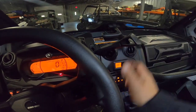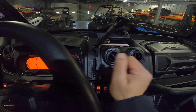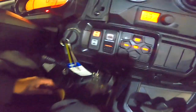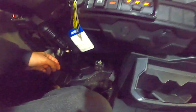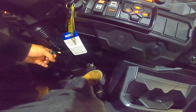The gear selector is just like on my 2019 Defender XMR — it's on the dashboard, it's gated. Some people don't like this and prefer the Polaris where you can just slide it up and down. This does have a parking location where it locks in place. Something my Defender does not have is a parking brake. To set it: push the brake all the way down, pull up, then release some pressure on the brake pad and it's locked in place.